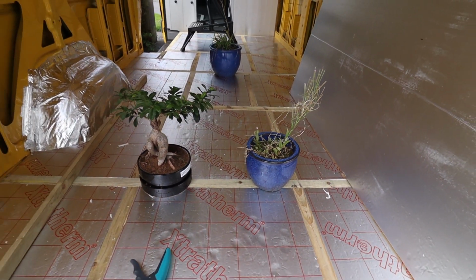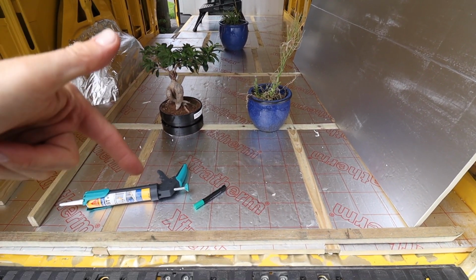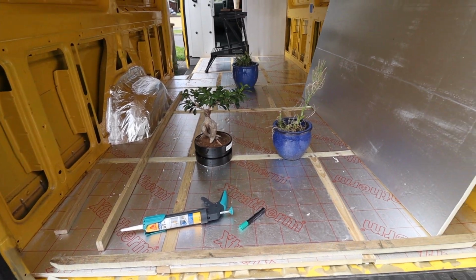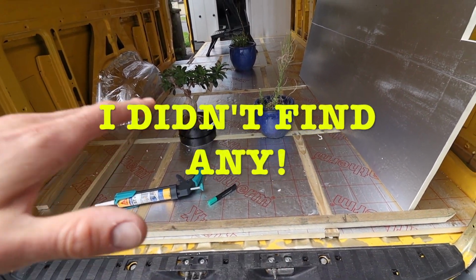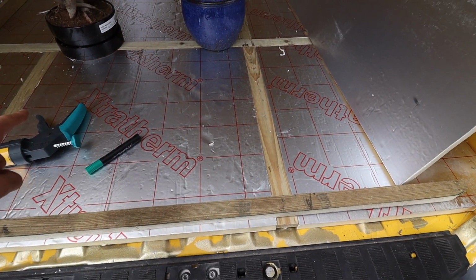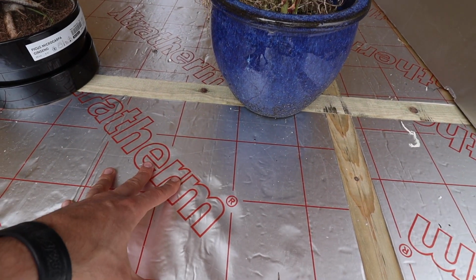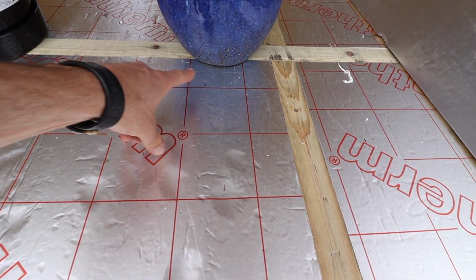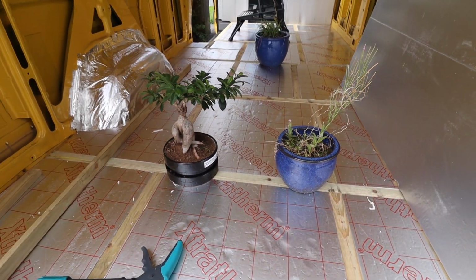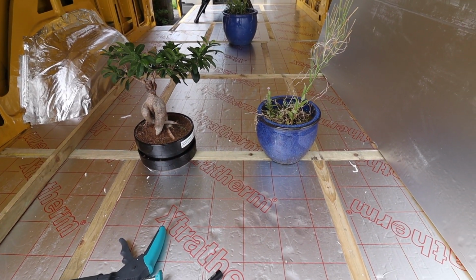So what I'm going to do is remove everything from the back of the van, go around, press down on the battens, make sure that all the battens have been stuck down correctly. And if I spot any batten that hasn't been stuck down correctly, I will remove the insulation, stick a bead of Sikaflex under whatever batten. So say for example, if it was this batten, I'll remove this insulation, and then I will run a bead of Sikaflex under it, and I will put back down the heavy plants on top of the batten,